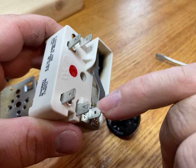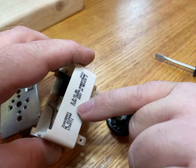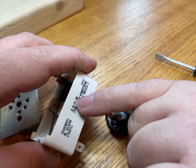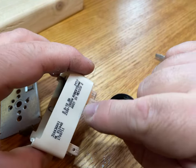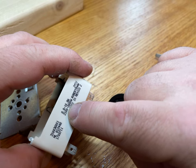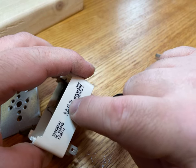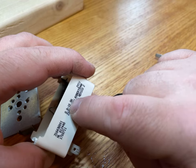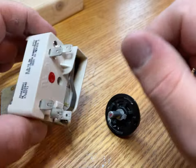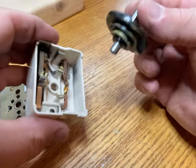As long as the amperage is within a similar range, you could get away with a little bit different — not a lot. Like I would use a 9 or 11 amp on this one; they're real close. But I would not use like a 4 to 8 amp — no, no, no. Anyway, the terminals for the pilot are the main difference.